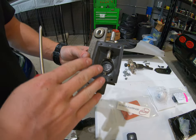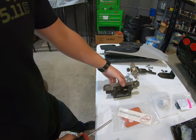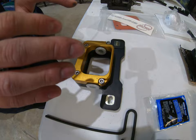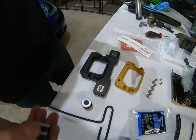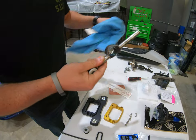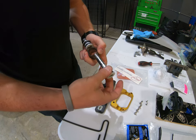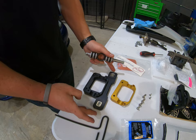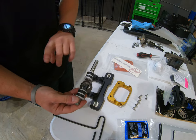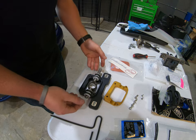Now you're going to go ahead and take the factory linkage rod out. It's just two screws right here. Pop those out, pull it out. If yours comes assembled, just go ahead and disassemble it. Clean up your factory linkage rod — take a towel, clean it up a little bit. Now that this is disassembled, slide those on. With the ears away from you, put this so the longer end of the linkage rod is to the left. Just like that.